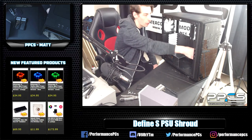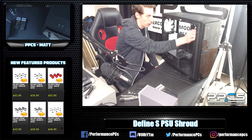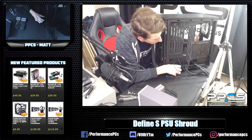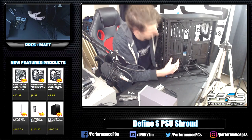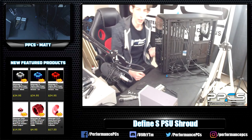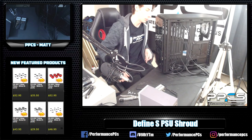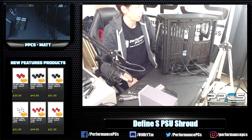For the custom reservoir - I'm just going to cut out this part of the metal here, and then with a piece of five mil acrylic it'll basically be the front plate that'll just bolt around the edges. In the back of the case in the Define S there's nearly two inches of width, so we're going to have the rest of the reservoir stick out back there and hopefully get it pretty flush with the back. That's where all the fluid will be held, bolted in with the front panel. We're also going to tap some G1/4 ports in the acrylic. I've never made a custom reservoir of any kind, so this is definitely going to be an interesting mod to do.